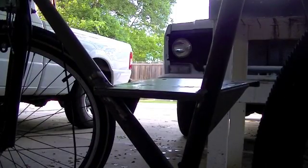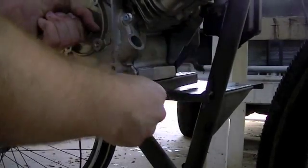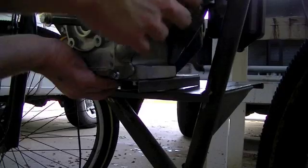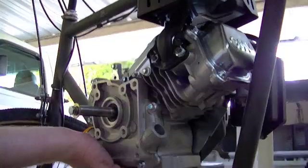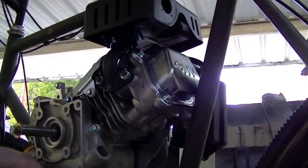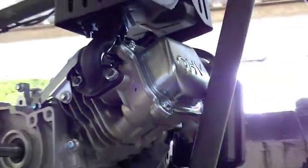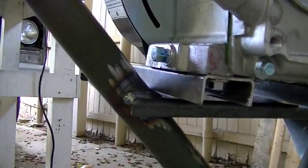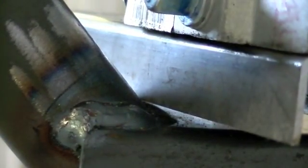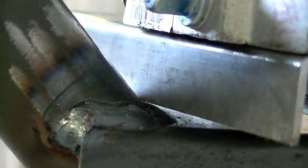Let's have a look now and see how this engine is going to fit in the frame. That's roughly how it's going to go. I've taken the fuel tank off — it's still hitting right back there at the back of the frame, at the rocker cover and valve cover. Right up here in the front you can see how the little extension arm is resting on part of the tube, so I'll make a mark and I'll have to make a little notch on my extension arm there.